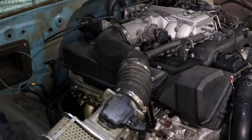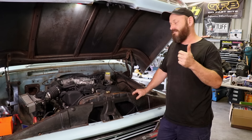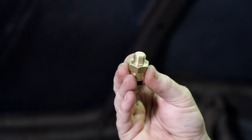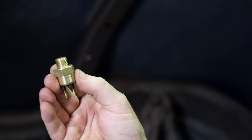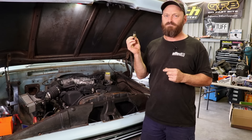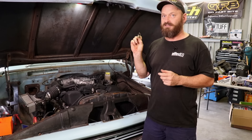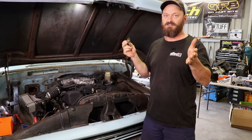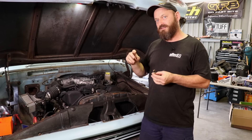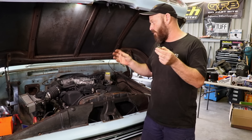On this particular engine, they're built to run at fairly high temperature — it's all aluminium. Many other Toyota engines, a lot of Nissan engines, same thing. What we were doing with them is using this thermo fan switch, which is originally fitted to a BMW around the 80s, early 90s. It's actually an auxiliary fan switch, so they had a series of switches that turned on different fans at different times. This one here is the right temperature range: 95 degrees on, 91 degrees off — that's in Celsius. The reason we use this switch rather than aftermarket stuff that just has a single terminal is the dual terminal setup gives you more control over how you wire it.